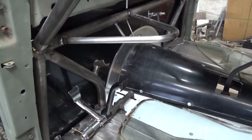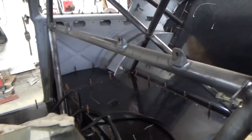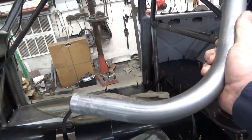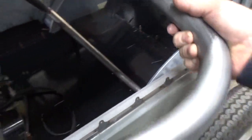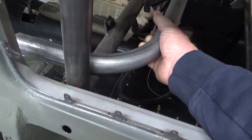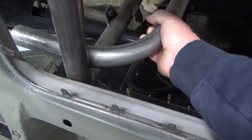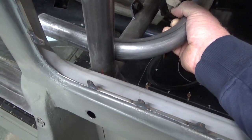In my last video I talked about pedals and how I figured them out. I can see I got the tin works all roughed in, ready to pull out and bead roll. What I want to talk about is a curved back brace and how I put that in. Typically what I do is try to go about four inches back, and what that does is make the intersection point between the main hoop and the back brace in the middle of the curve. It's something that's super hard to calculate — I've just never been very good at that, so I'm going to show you how I do it.